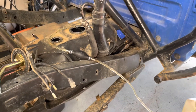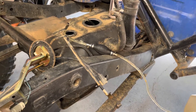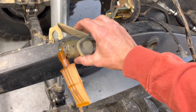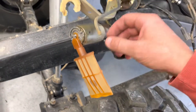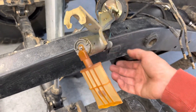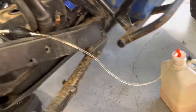I was having to keep the Toyota pretty full because if it got down to three-quarters of a tank it would cut out. The reason why is the tank has been bashed in so much from rock crawling. I figured out this sending unit got bashed at some point and was knocked out of its cradle, so the fuel pump itself was kind of wiggling around in the tank — that's probably a big part of the issue. But anyway, set that aside for now.